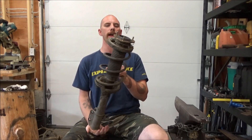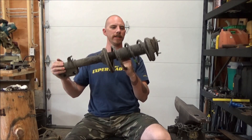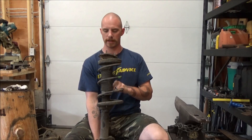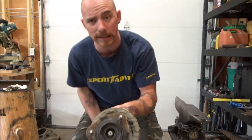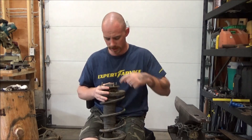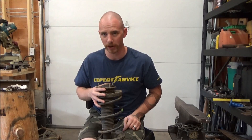Great steel and we want it, but we've got a problem. This thing has a lot of stored energy — the spring is very much compressed. You can see there's a little nut on the inside you can use to get that off. If you put this down, stand over it with a wrench and unscrew it, that compressed spring is going to decompress and send that shooting up at what might very well be your face.